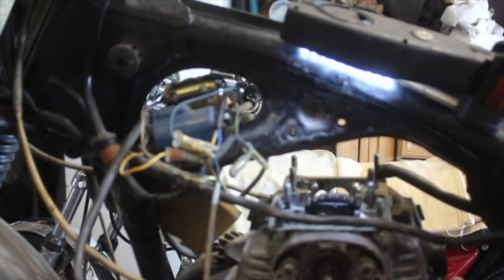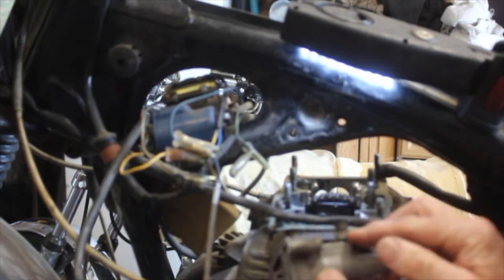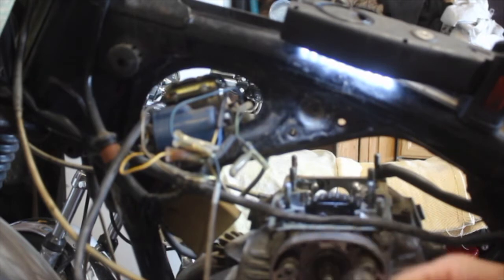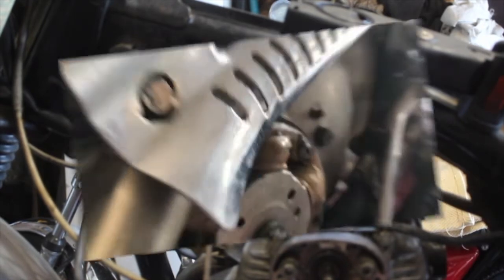And when I put the cam chain tensioner back on, which is this fella here, I will release that, and that little gizmo there is sprung, and it'll pop out like it has done there, and it'll tension the chain for me. And it is that simple. So I'll pop it back together now, and I'll rotate it through a cycle, and then you can see that it's exactly where it should be.